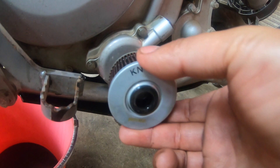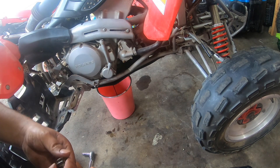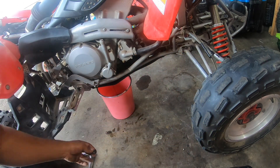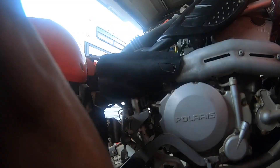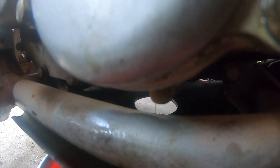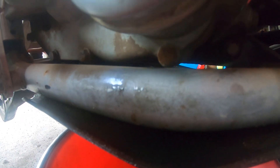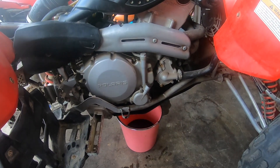To dump the oil out, there's the reservoir up here and the engine drain right in that little hole right there. This is what the bolt looks like — it's a size 14, and size 14 fits it perfectly. It should be the same for the reservoir. As you can see, it's draining out right where that hose is, and the guard underneath the skid plate — right in that hole in the skid plate — is the oil drain. Size 14, remember that.